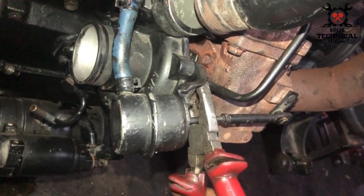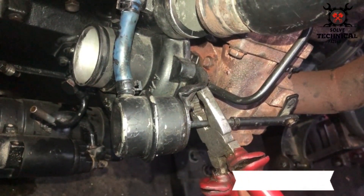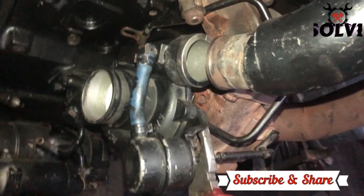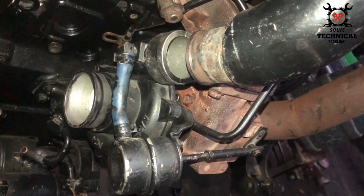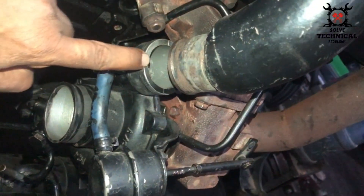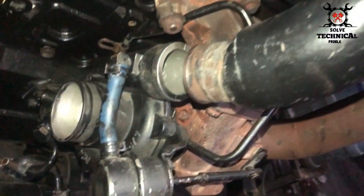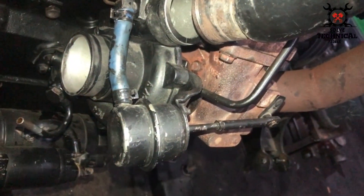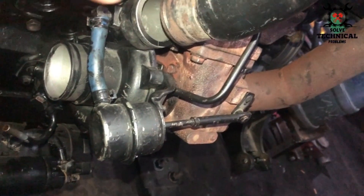The spring tension is almost 10 psi for the wastegate valve — you need a pressure of 10 psi to open the valve and move the lever. When the pressure inside the intake manifold increases to 10 psi, this pressure is shifted to the pipe.